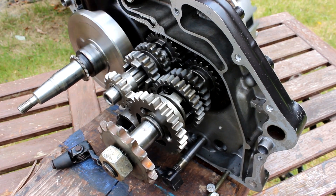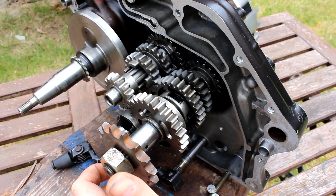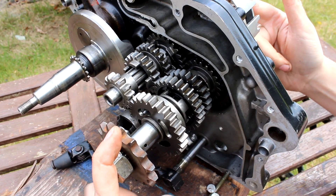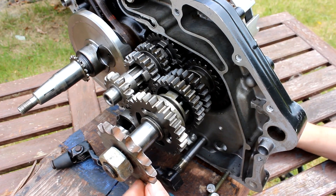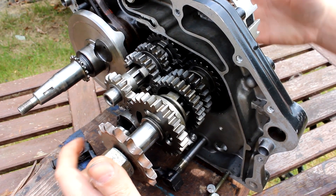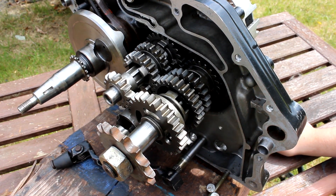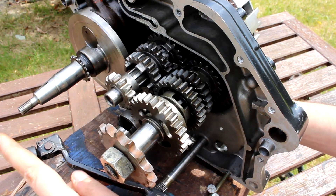At this point you can see the engine is turning and the gearbox is turning — that's because we're in first gear. How do we know we're in first gear? If you take your finger on the very top tooth here and do a full rotation on the input side, we've only done about a quarter of a rotation on the output side. That means lots of RPMs but lots of torque, because you're taking lots of movement and concentrating it into smaller, more powerful movement. That is first gear — same principle as a block and tackle.